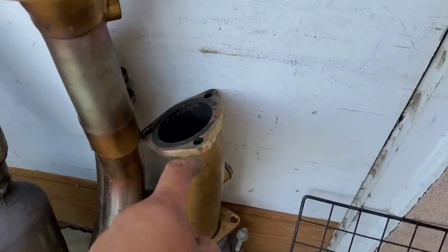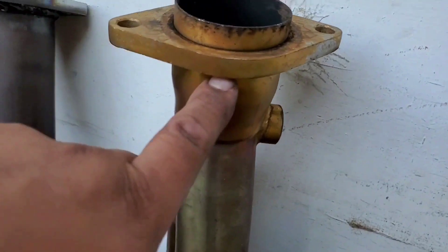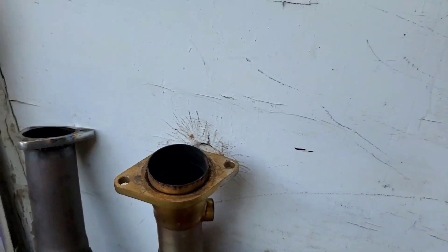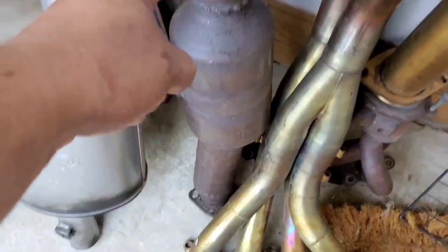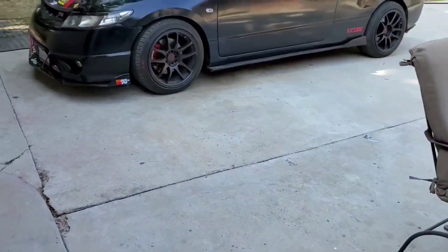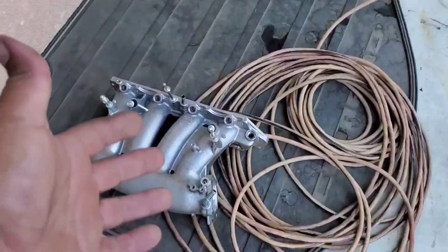I have my cat that I fabricated, my muffler, stock header, and these are some PRL headers. What I'm gonna do is cut this three-inch flange off, grind this off so I can leave this here, then slide that one on there and weld it on so this can bolt to the cat. That way when I need to smog it, it's ready.